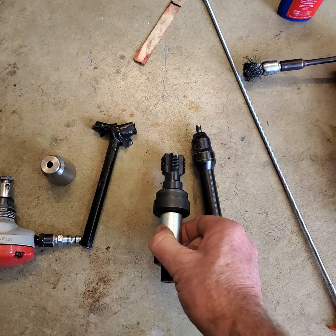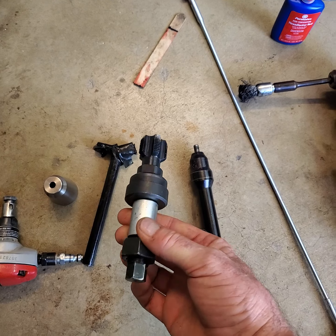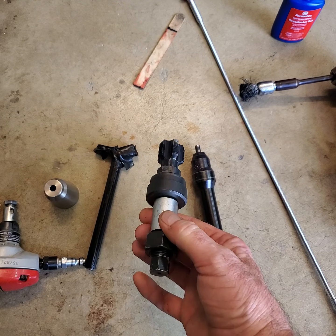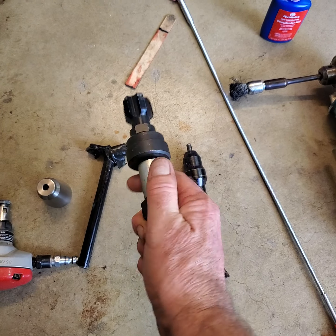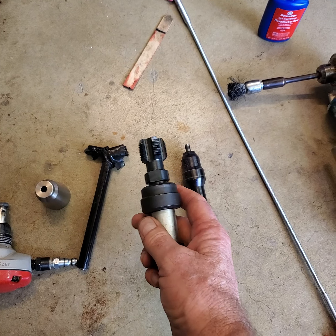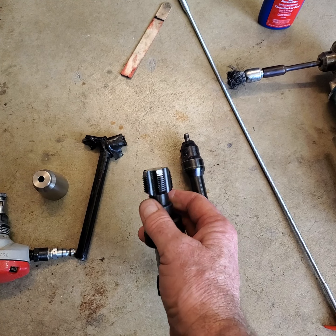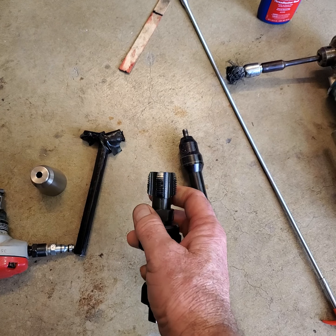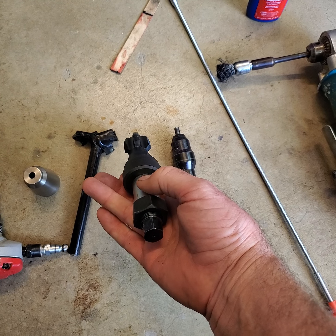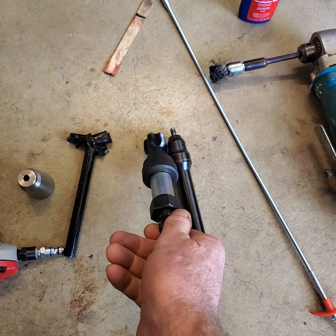This thing was a learning curve because, yeah, I bought that on eBay, and yeah, it was cheap, but I had the Alliant, the copper ones or hard brass. I was turning and turning and couldn't get the thing to grab. I know it will grab on brass, but I had to make it grab on that hard copper stuff, the OEM stuff. So I took my sander and sanded off this portion all the way around, and then stuck it down into the injector cup, gave it a few whacks with the hammer, and then it would grab, and I was able to begin to spin it.